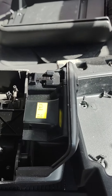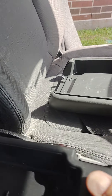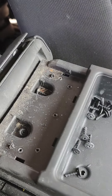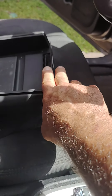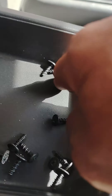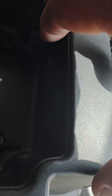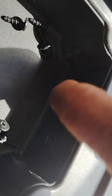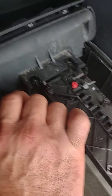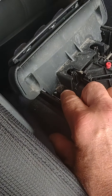In this particular case it's this simple. The tray lifts off like this — you take the top off, then there are several screws back here, followed by four screws on the bottom, and then two more up in here, which are kind of hard to see in this light — one here, one here. That lifts the whole tray off.